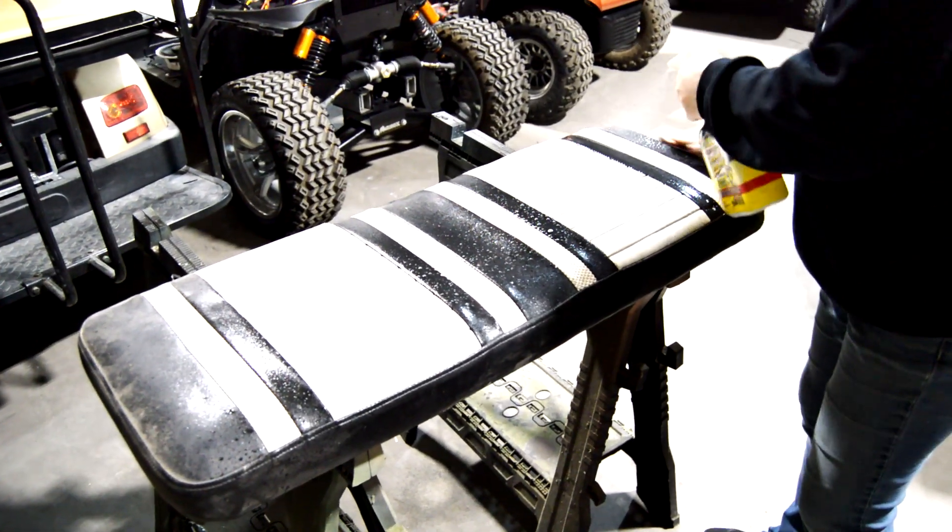For more textured vinyl, you probably want to do more of an aerial shot with it if you can, to drop that paint into those little spots. After about 15 minutes, you have this beautiful top coating and it looks wonderful. Come over here — you'll see on our cart it's looking just as good as these seats we did nearly a year ago.